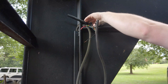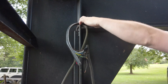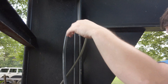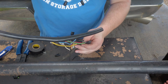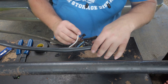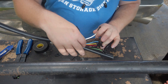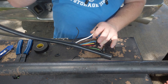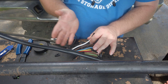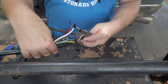To make it easier on myself I'm going to retrieve this cable back through here and get it down on this box so I have plenty of room to work on it. Now what I want to do is cut these wires individually so I don't have one lump where I'm soldering. I need one that's going to be longer, then it'll get shorter and shorter, so it lines up to be more like one piece instead of a mass I'm trying to feed through that small half-inch tubing.